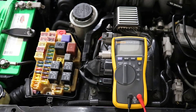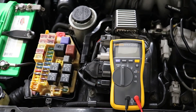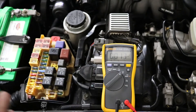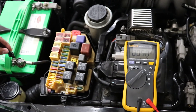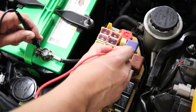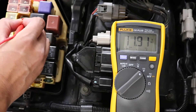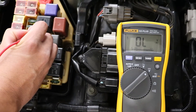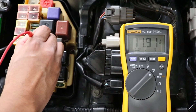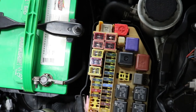The next thing we're going to do is test some fuses. Here in this junction box, we're going to test about five fuses. This is a very common test if you're trying to troubleshoot something. We're going to put our multimeter to DC voltage, then ground our black lead using the negative post on the battery, and then probe the fuses. The first reads 11.91 volts, the next 11.9, and the third, fourth, and fifth are the same. That's how you test fuses using a multimeter.